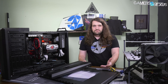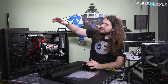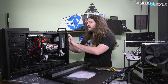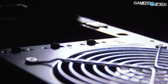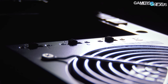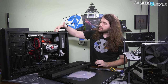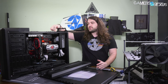Spoiler: the answer is no. But that's just because once you have this many fans, any natural physics is completely irrelevant. Intake is on the bottom, there's a 120mm in the top for exhaust, and the power supply gets air through the back with its own filter. Up front are three switches to control fan speed, ranging from 1200 down to about 800 RPM — a quite significant reduction in noise, which we'll discuss in a moment.